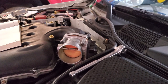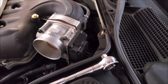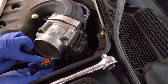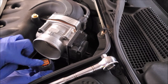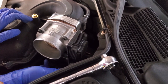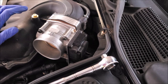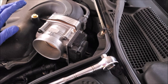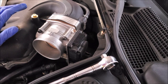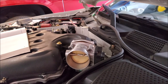That way you know your torque wrench is working, and moving up in increments will feel a lot more comfortable. Another optional thing I'm going to do is put a thin layer of dielectric grease inside this plug — it's safe for plastics — and work the plug a couple times then snap it on. A lot of people say you can't do that because it'll impede the connection, but dielectric grease, especially after plugging it a bunch of times, has very good properties for displacing and it creates a membrane inside the plug. If there's any moisture getting in there it's going to help protect those metal prongs and you'll avoid any corrosion issues.